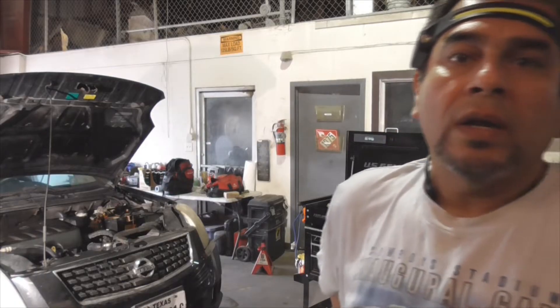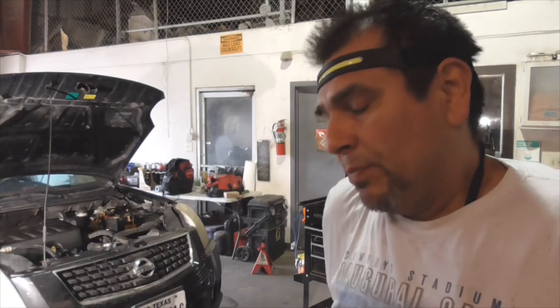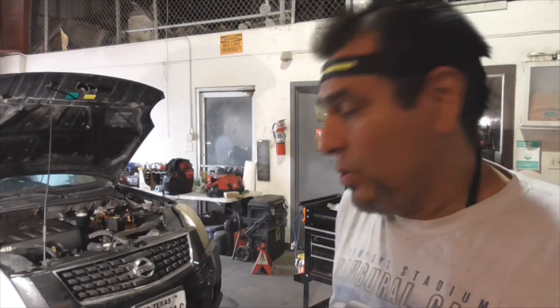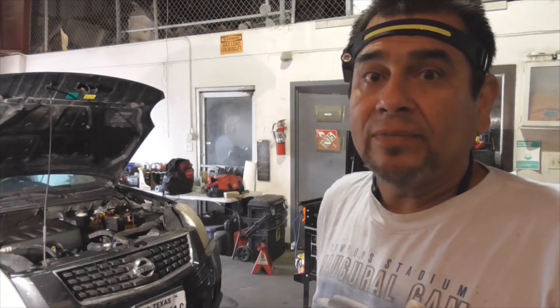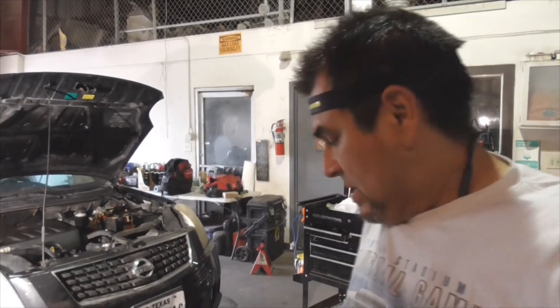Okay guys, we are continuing with our step motor replacement for DTC P1777. The P1777 is an electrical code that is sent when the circuitry to the step motor fails. It's real important that you understand that P1777 is an electric code. I saw a couple of videos that had the proper procedure and about four videos that had the wrong procedure. I did the wrong procedure when I put the actuator body back, and if the transmission will not shift after 40 miles an hour, stays at 3000 RPM, and you get a P1778 code — this is what you did wrong.